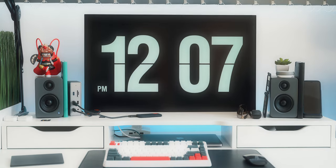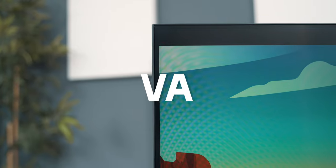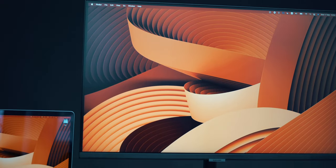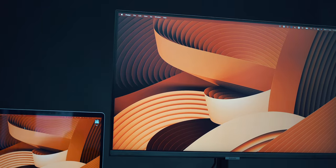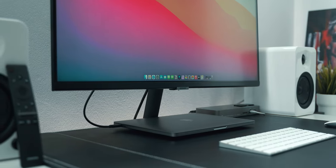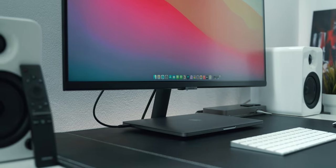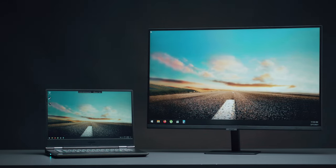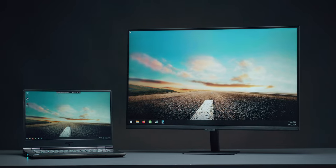Here's what we're dealing with: a 4K panel, 3840x2160, but unlike the desired IPS displays, this is not an IPS — it's a VA panel, which stands for Vertical Alignment. VA panels are something of a compromise between TN and IPS. They offer the best contrast ratios, which is why TV manufacturers use them extensively. In terms of viewing angles, VAs cannot match IPS performance, and screen brightness in particular can vary based on the angle — that's my first complaint with the M7. But you won't get IPS glow, which is typical of my current favorite monitor, the LG 32UD99, which costs three times as much as the M7. This being a VA panel eliminates recommending it to avid gamers, though for me, even at 60Hz, it does the job no problem.